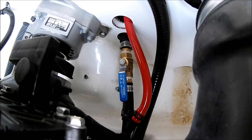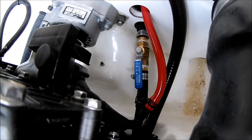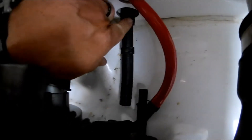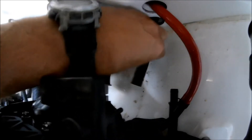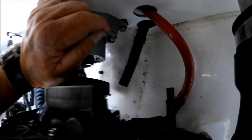You can see I've got one installed — the red hose coming in is from your flush point, and the valve is on the cooling water line coming in from the jet pump. That's where you want to put it. Going to the other side, I've already got the hose loose off the Y adapter. You can open the clean-out ports and take that center piece out to reach in from behind and push the hose back. You can push it back without cutting — I'm going to cut some off just so I don't push too much back. When you push it back it just bows the hose slightly, no crimping.